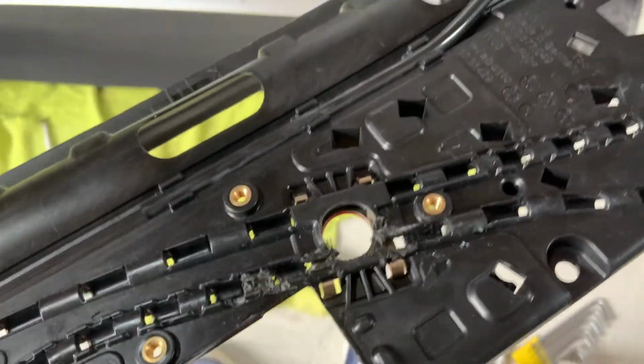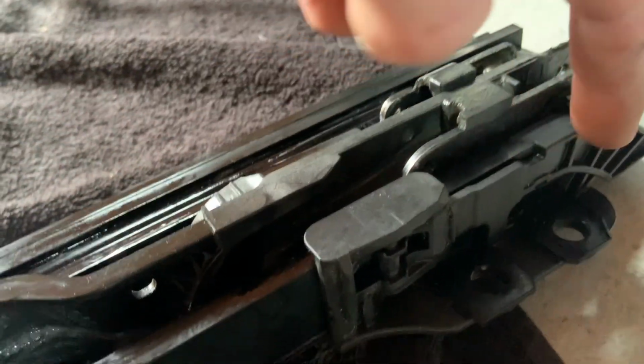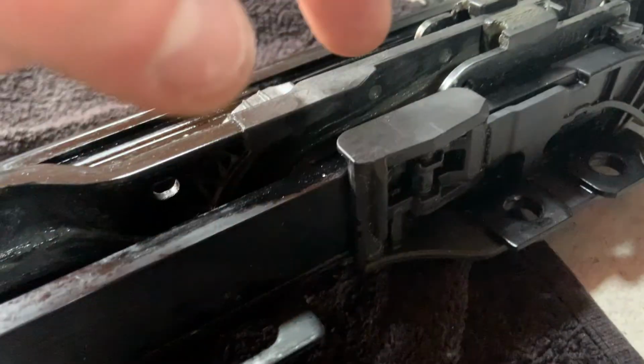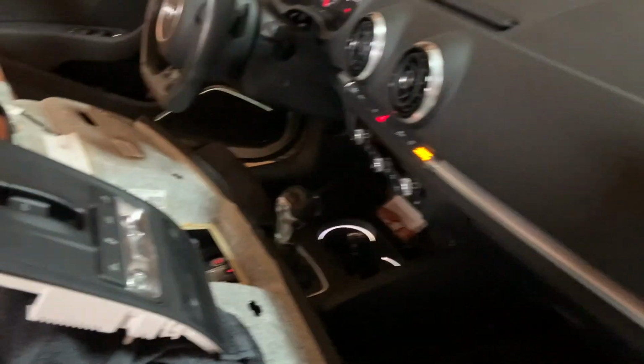So remove the old part, the broken plastic piece from the rails. The only thing that's holding it up are screws from the blind and the cables. I also fixed the little plastic piece in here. You can take this part off, and there is this piece. I will insert some photos. You can take this part off, take this piece out, and I made a new tab on it with some epoxy. And let's see, put it all back together, and let's see.